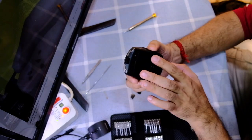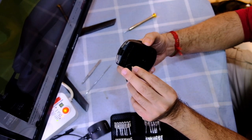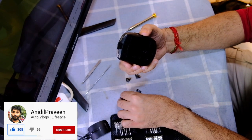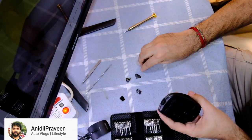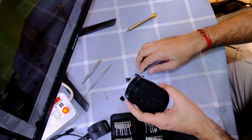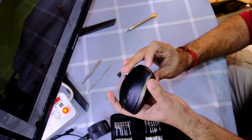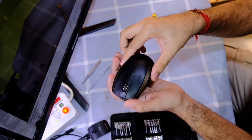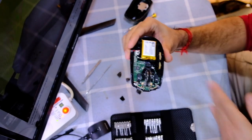This mouse has four screws which are hidden underneath the bottom pad — that's a rubber pad. You just take it off and you get four screws. I've just removed the four screws, and once you do that you just pull it open neatly. This is how it looks inside.